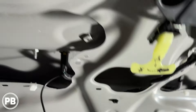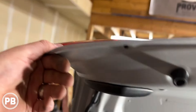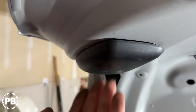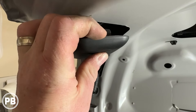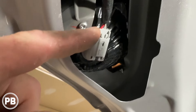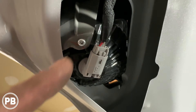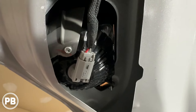With the panel back on, our camera comes through underneath at the new grommet. The reverse light is actually in the deck lid, not down in the body, which means we have access to our trigger wire and ground right at this location. The power wire is red, and the ground is always white with a black stripe. We strip the shielding back to have access to those two conductors.